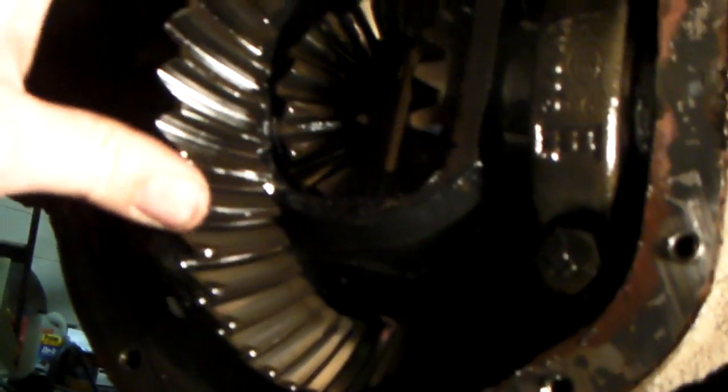And then once you've made an initial check and everything still looks good and everything's tight, this differential doesn't really have any looseness or rock to it, so that's a good thing. If you need to spin it, just reach over and spin a tire, and that'll spin those spider gears. To spin the ring, you're going to want a friend so you can spin both tires. But usually what's going on one side of the ring and pinion is going on the other.